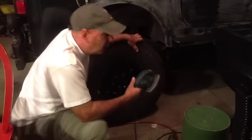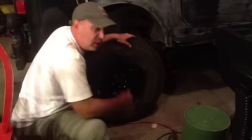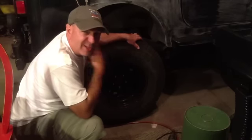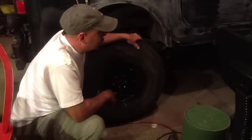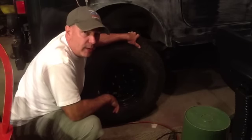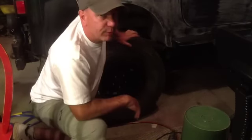Once I get the primer thrown on, I'll use 400 grit sandpaper. This gave me a chance to go ahead and fix some of the body damage. This Jeep was really not well taken care of body-wise before I got it, so we're fixing a lot of those flaws. For my first run, I'm going to test my painting ability with a door. Tomorrow morning, Melissa and I will mask off the doors and I'll learn by trial and error painting the doors first.